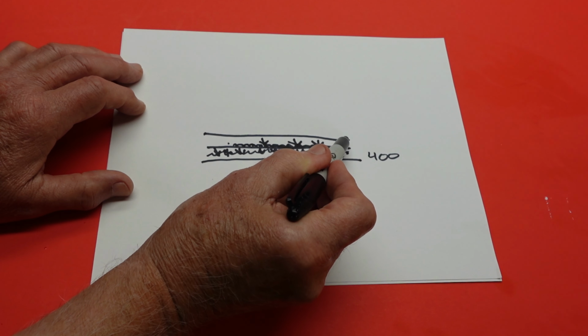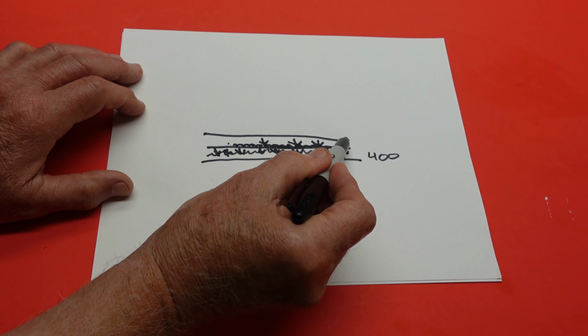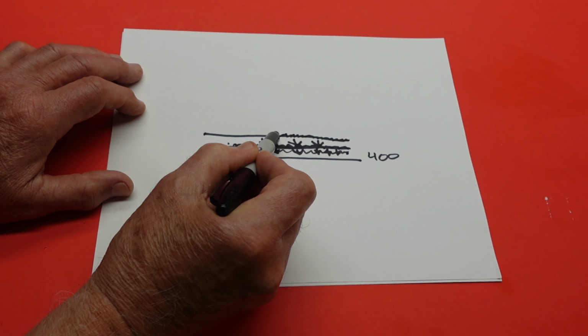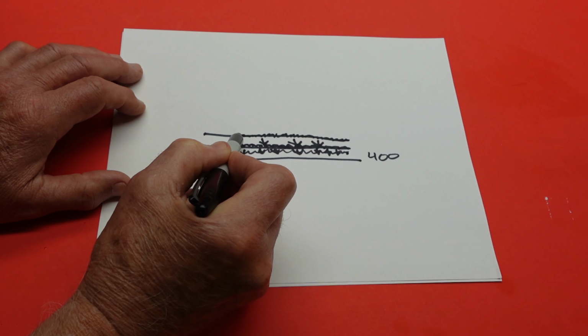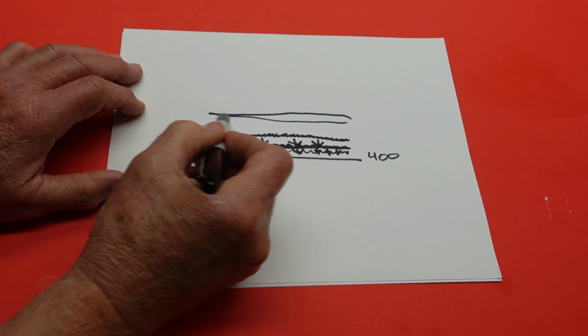Now, this paint here, a lot of times, modern paint that's made to have clear coat, it dries with a very slight, it dries dull. If you look at it, it's not shiny. It has that microscopic tooth. And now you put on 3, 4, 5 nice coats of clear.